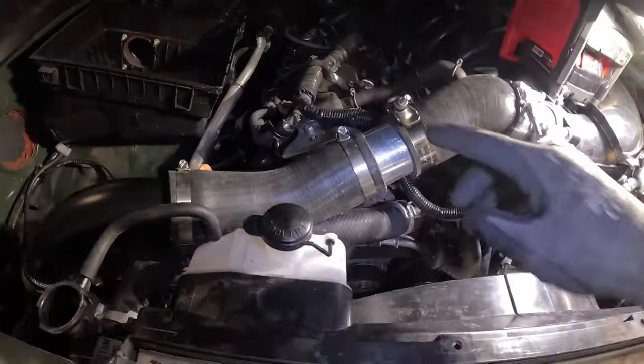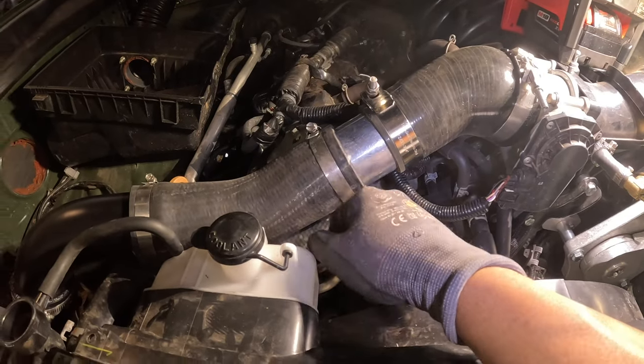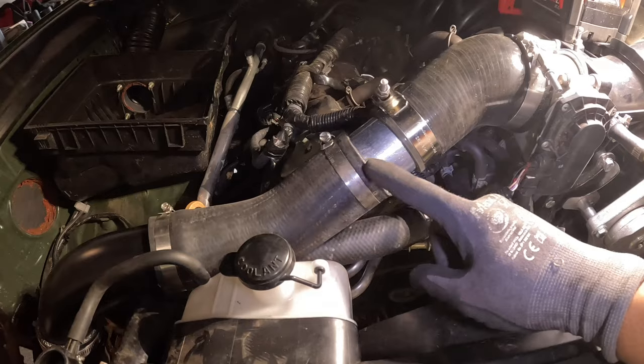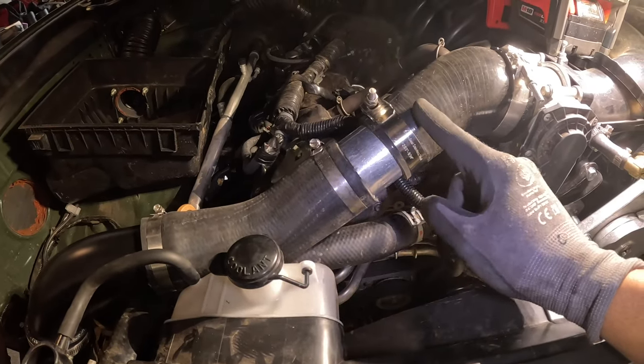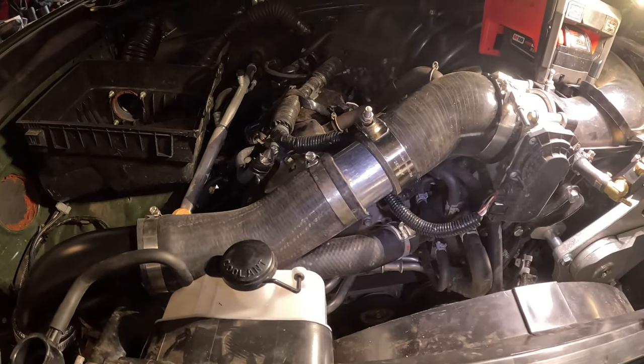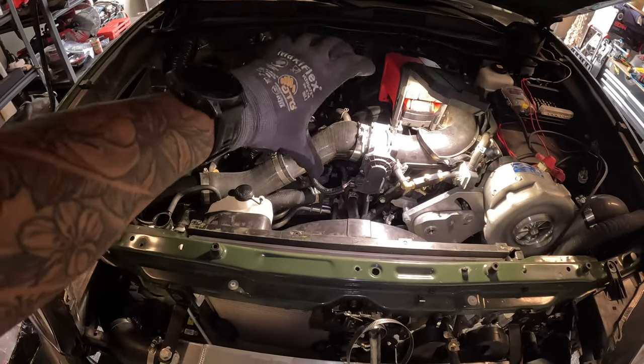Since I was running into issues because I was missing that one pipe, I started routing everything else. It's a two-and-a-half inch aluminum pipe anyway, so I took some aluminum pipe from my friend, cut it the right size — about four-and-a-half to five inches long — and after everything was routed, a 45-degree bend didn't seem to fit well right there, so I just did a straight two-and-a-half inch pipe. Got that all connected going to the throttle body with the silicone.